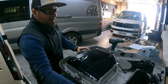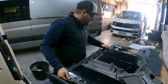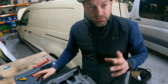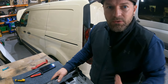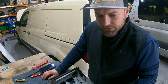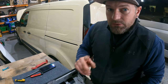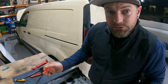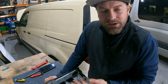Once this piece has been completely sorted — I believe there's one bit around here — remove it and put it to one side. Now we're going to look at removing the top gray panel, which is the part on the top where you rest your arm. It's a little bit different — we're not going to grind anything away. We're simply going to heat up the spot welds and then use a trim tool to gently prize it away from the top plastics, because we want to be able to reuse the holes to allow the glue to sit when we attach it back together.